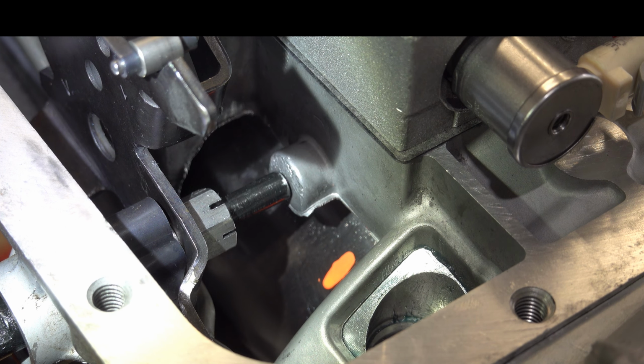All right, we're going to take out the servo, but one thing I recommend you do before you even do that is spin the drive shaft. The caveat here is that you have the vehicle up on all 4 jack stands and the transmission's in neutral so that you can spin it without any issues. You want to spin it in the opposite direction of engine rotation so that you can get a sense and a feel for what no drag actually feels like when you're spinning the reverse input drum underneath the band. That way, when you reinstall the servo for a trial fit and test after you've made an adjustment, if there is drag, you'll know right away.